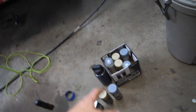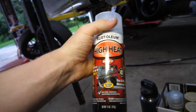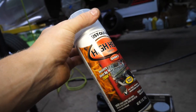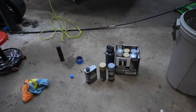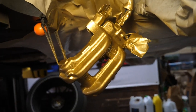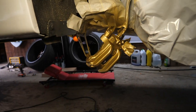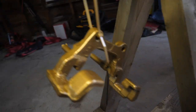After doing my color coat with the gold, I went inside, had lunch, gave it about 45 minutes, and then hit it with this Rust-Oleum high heat gloss clear coat. It's a very universal product but had a high enough heat rating that I felt comfortable using it - that's just what I could get my hands on in the timeframe. Give you a quick look at the rear calipers as well - I didn't go quite as hard on these with the prep work and you can kind of see that; it's a little more of an orange-peel type finish. But we're really only going to see this face of the brake caliper, so I'm not too concerned about it.